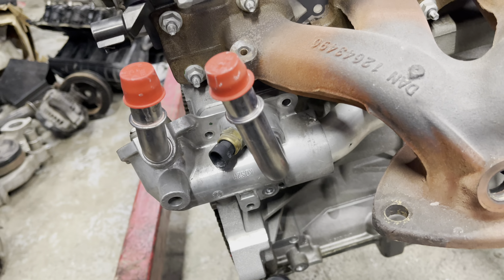Just snug them up until you get them all pretty much snug, then use the angle wrench to pull them up. Double-checking them all — all right, those are all tight. Crossover pipe and the thermostat housing back installed.